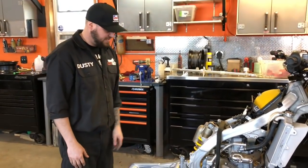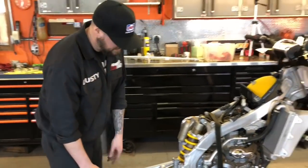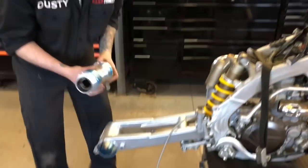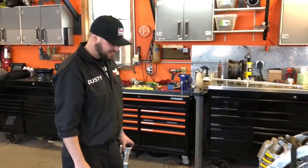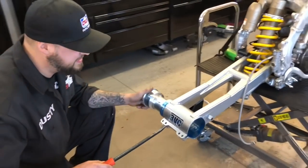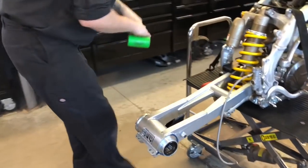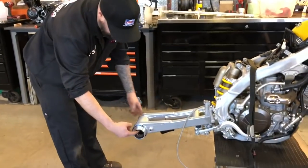So we're going to show you how to install the bearing carrier into your swing arm and the axle. I already installed the shock — that's pretty easy. Put the bottom of the shock in first, put the bolt through it, find it at the top shock, same thing. You want to put a nice film of grease inside the carrier. It's a little bit easier to grab a pry bar and just take your time and work that in. Grab a rubber mallet. Once that's set, you're going to want to put a little grease inside your bearings on the seals before you slide your axle on.